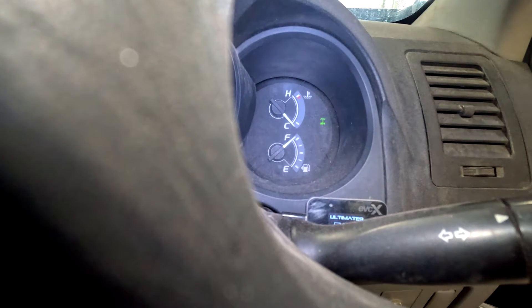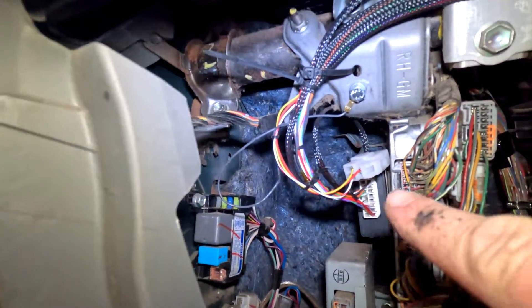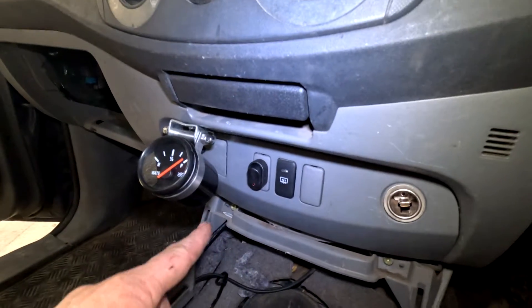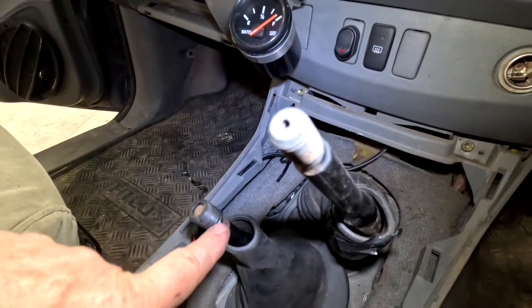See, there we go — there it is. And if I take it out, there's the light going out. Interesting enough, this one actually already had the light coming on and off because the plug for the high-low engagement switch is the four-wheel drive — same plug as the four-wheel drive switch on this model. It was the gearbox that went into it, so this has got an earlier model gearbox with the right-hand drop in it to suit the solid front end. And this engages low box and engages the four-wheel drive.